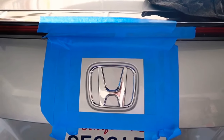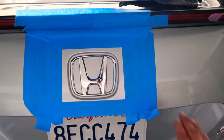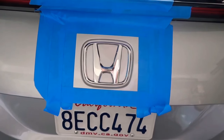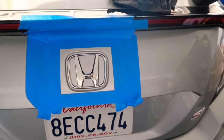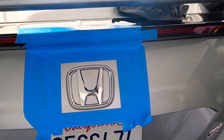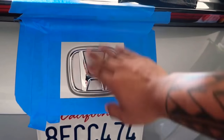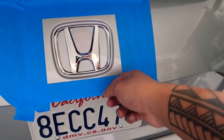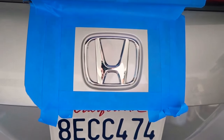So this is how I did mine. I put a little bit extra on the sides because it does go everywhere when you spray it. I made sure to cover up the spoiler area because if it gets in there, it's going to be hard to get out since it's in hard-to-reach places. You want the tape there because when you put four coats on and then peel the tape off, it rips around the whole H emblem cleanly — that's why the tape is really important.